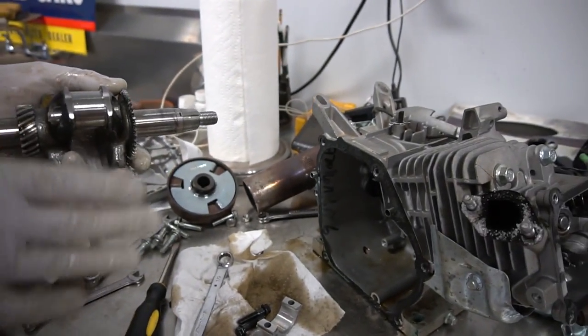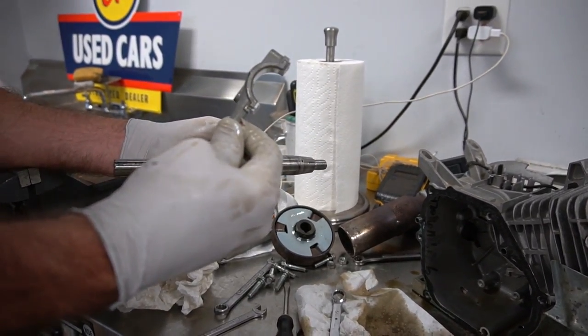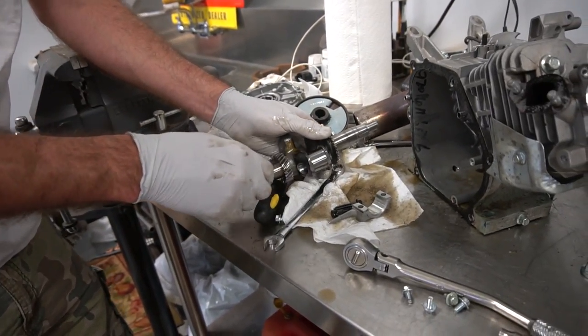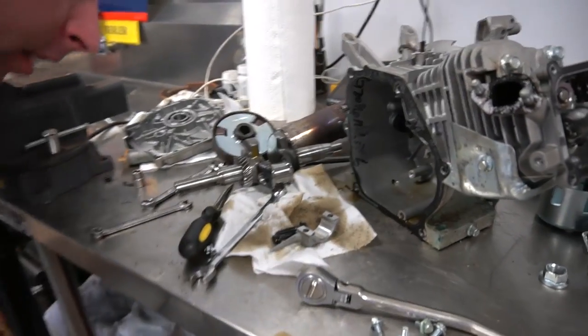Right here where the rod rotates and goes back and forth on this crankshaft as it spins, it was completely eaten up and fused with the rod. As it was rotating and got fused, it broke the rod and put a hole in the block. It was lack of lubrication caused by us not using a billet rod — but this engine is fine. The last engine is not; it's dead, very dead.